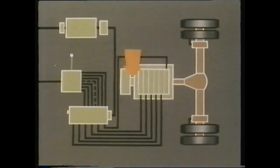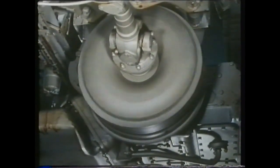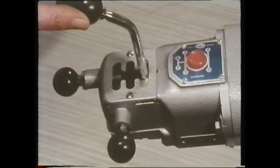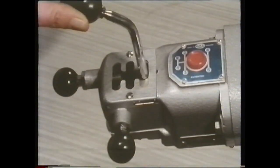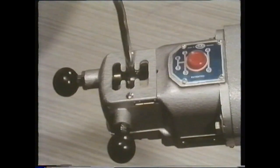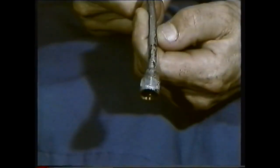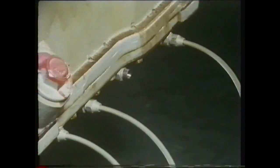With a remote mounted gearbox, you can confirm a stall no drive condition if you check the small prop shaft between the flywheel and the gearbox. This will be stationary when the change speed lever is in neutral. Here's an example of a stall condition in the transmission. If the vehicle drives in neutral, it's an indication of a potential two gear situation. Therefore, to discover which gear is causing the condition, operate the change speed control through each gear in turn. Only when the change speed lever is in neutral and in the gear that is at fault will the vehicle move forward. Once the problem gear has been identified, the air pipe to that gear at the entrance of the gearbox should be released to determine whether the fault lies in either the control mechanism or within the gearbox. If there's air present at this point when the gear control lever is in neutral, it's the control mechanism that is at fault. If there's no air present, then the fault lies in the gearbox.